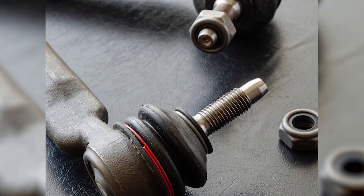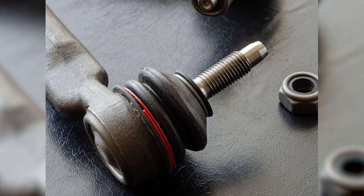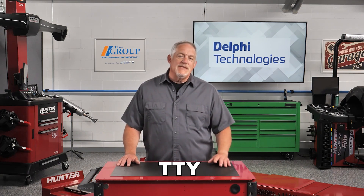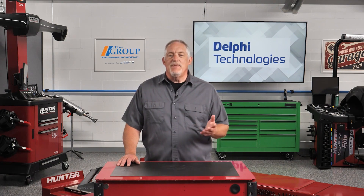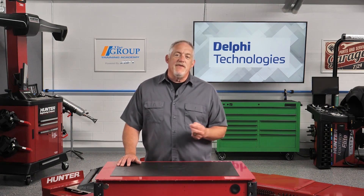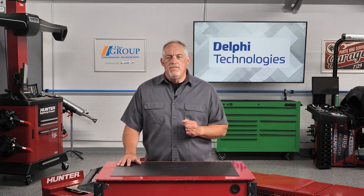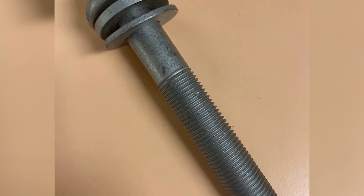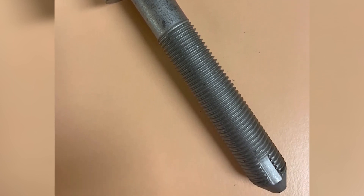The 7 to 10 degree angled taper, along with a threaded stud and nut, lock the components together by tensioning the nut and stud. Torque-to-yield, or TTY, ball joints and tie rod studs can weigh less and still apply the same clamping loads, with the added benefit of having clamping loads that are more consistent and controllable.